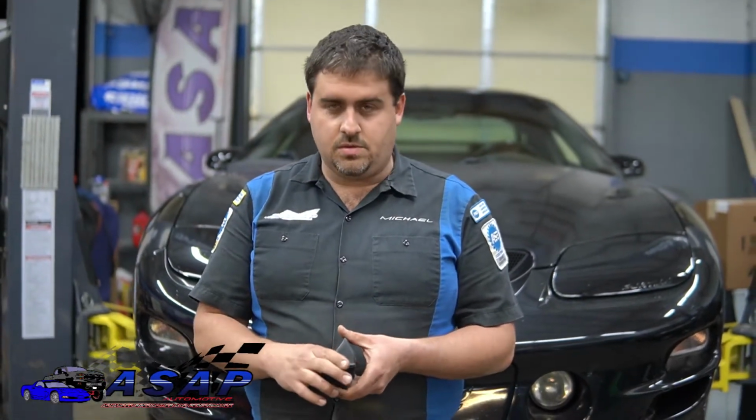Bump stops go in the back suspension of this car. Whenever you go to take off, like at a drag strip or light or whatever, the car wants to squat. It weight transfers, sets the back down, and it goes, which is good. It's what you want. But everything in moderation, right? You gotta have something to kind of limit that back there.